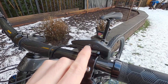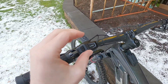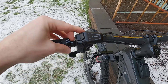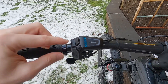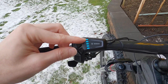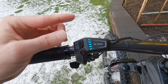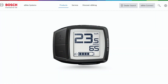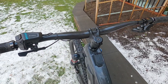On the top edge we have a power button and an ambient light sensor — that's what that little box is there, which is very nice. Because if you're riding in the dark and you don't want to be blinded by these LEDs, like some of the cheaper e-bike systems out there. We'll go ahead and press the power button and see this thing come to life. It walks through the battery level indicator — there are five ticks, but they actually give you 10% readouts. So if you drain 10%, that first LED will change from blue to kind of a white color. In the past, some of the e-bike systems from Bosch just gave you 20% increments.